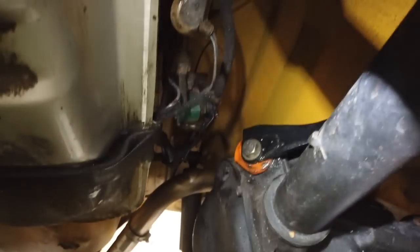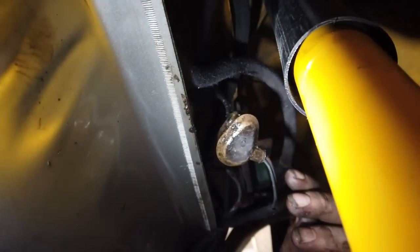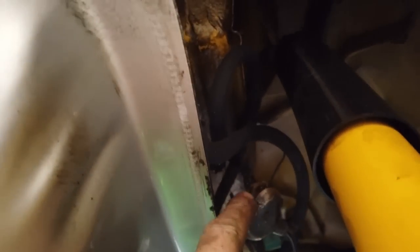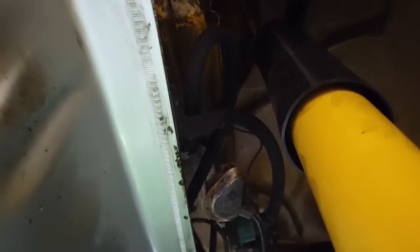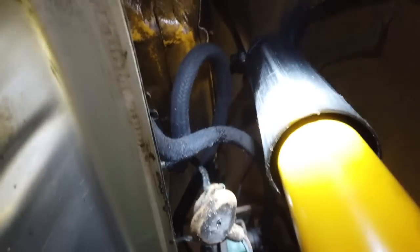Of course, you remember we fitted a new fuel sender and it's in. I've made an adapter plug. I just touch it with a torch now. Sometimes it's hard to get where you are. There we go. I couldn't bear to chop the Ford's fuel tank sender plug off, so I made an adapter using bolts. Actually, two sizes of bolts fit as the male lugs to plug into the loom. Then I've greased it up so we don't get any corrosion. So I've packed that connector with grease. I'll put a torch on it again so you can see. So that's an adapter that I've made to keep the actual original Ford plug,